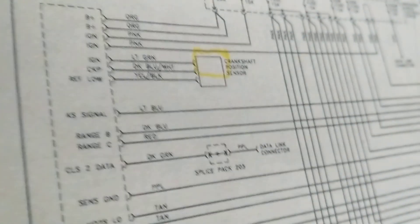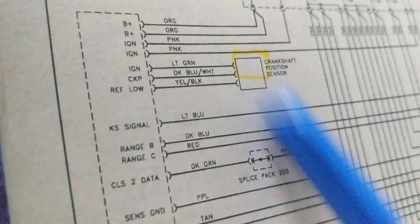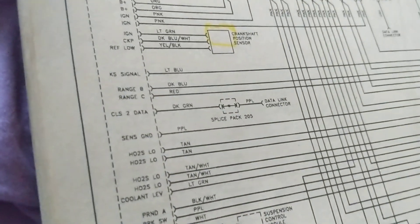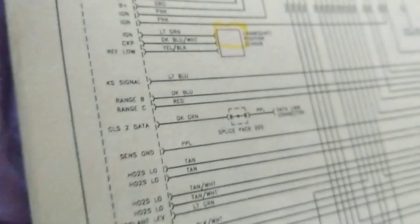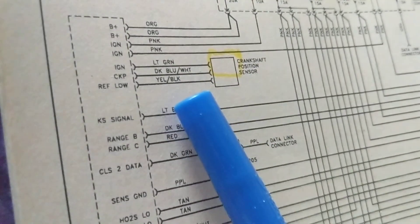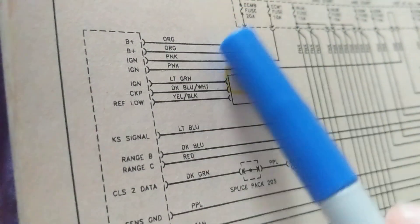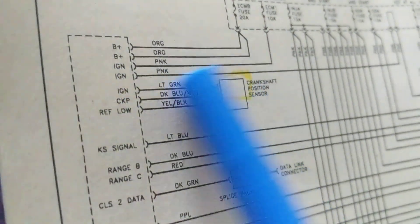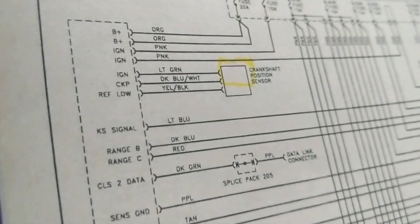As I showed on the channel, there are many circuits inside one computer module. The chips inside may need 3.3 volts, 5 volts, or 12 volts — broken down from 12 volts to feed different circuitries. So the module uses multiple supply lines. I cannot assume all are good just because I measured one.